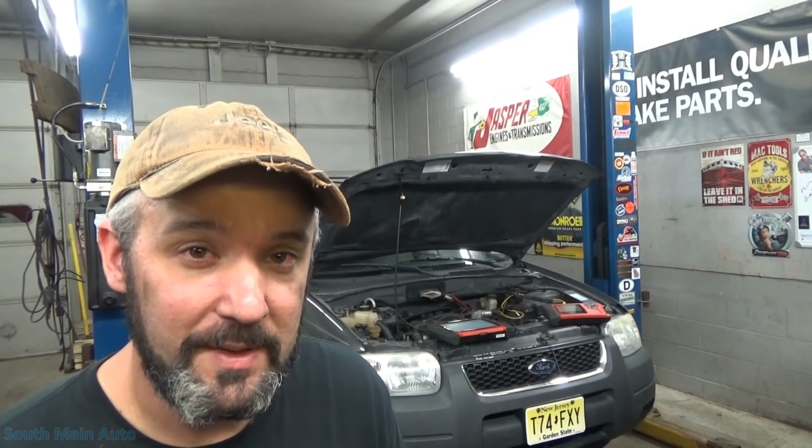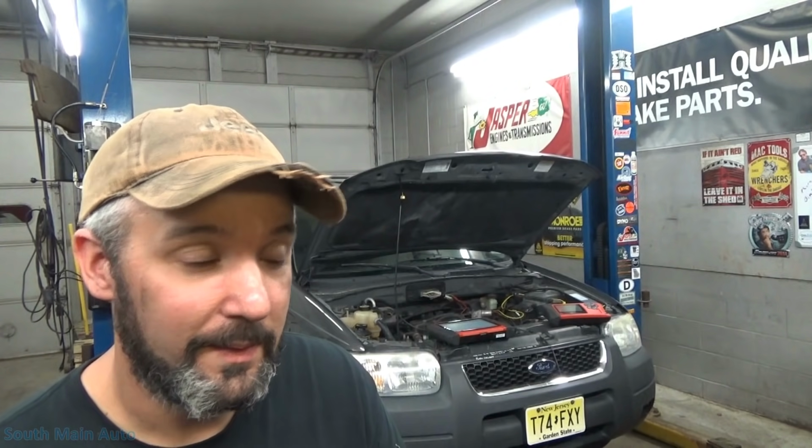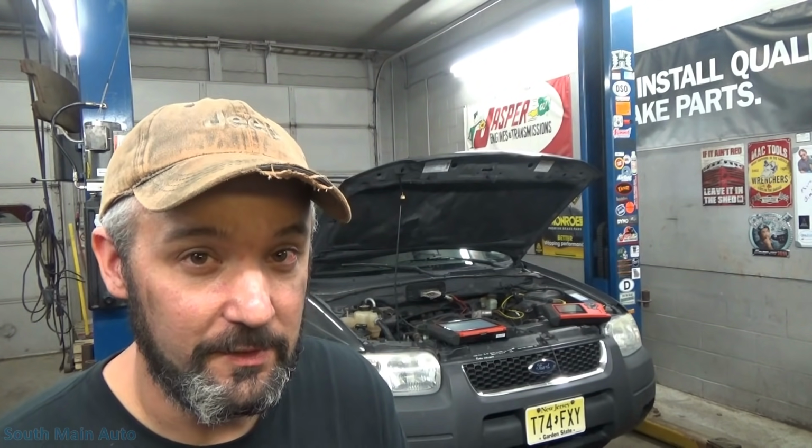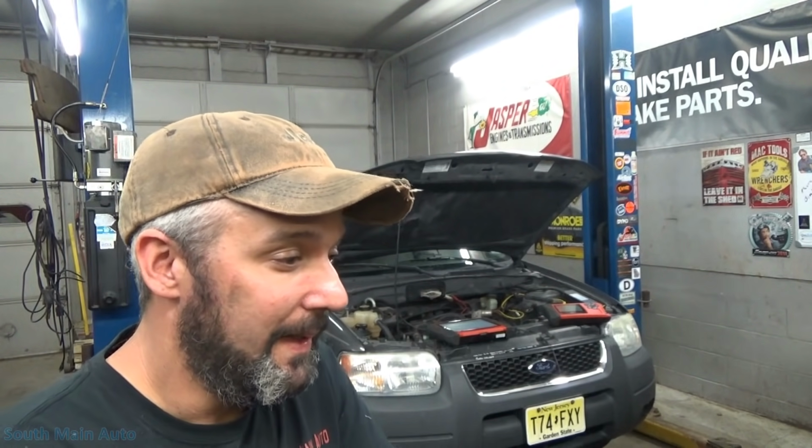The 3000 RPM mark was key, and that was key sitting with Keith too, like, yeah, that's too fishy that that does that. And the fact that when you unplug it, it doesn't do it. When you substitute a voltage, it doesn't do it. That's super weird. And that was the part we kept going back to.